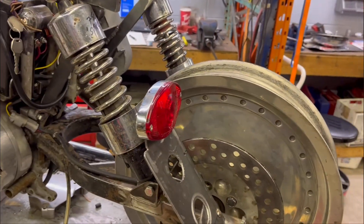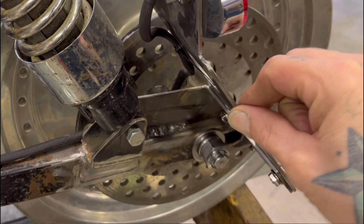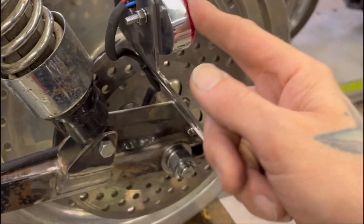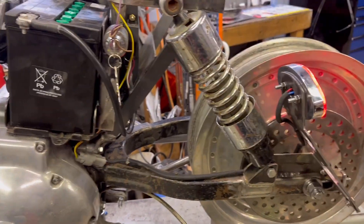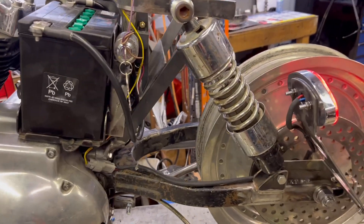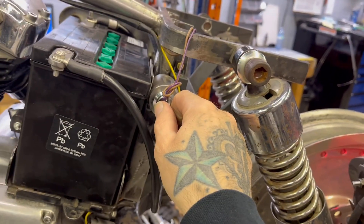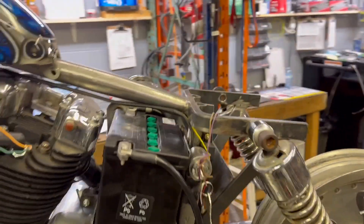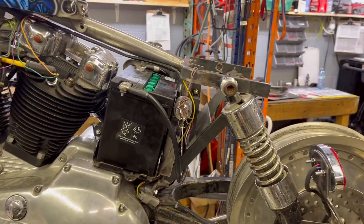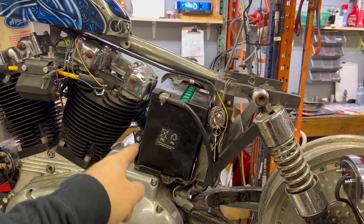We'll take a quick look back here. I've got the license plate mount — there are a few improvements I'd like to make to it after watching it run, but nothing out of the ordinary. Just a nice side-mount plate; I chose not to use it off the axle and put in a gusset here. We've got an LED brake light and tail light that will come on with the first brake application. I chose a two-position switch: in the first position the bike starts and lights do not come on; in the second position the headlight comes on — this allows a little bit of extra power going directly to the starter motor on these old bikes.